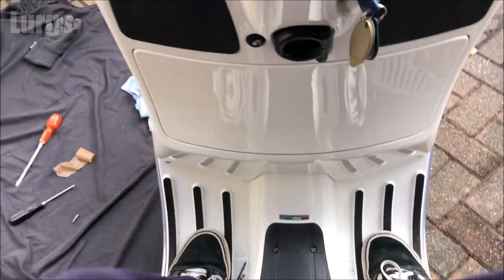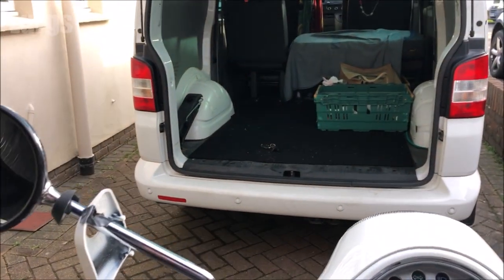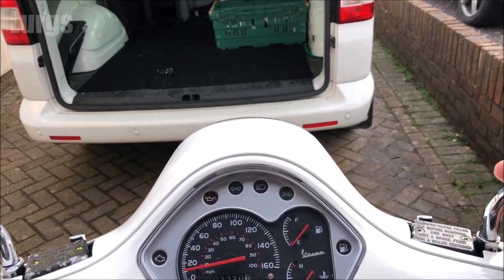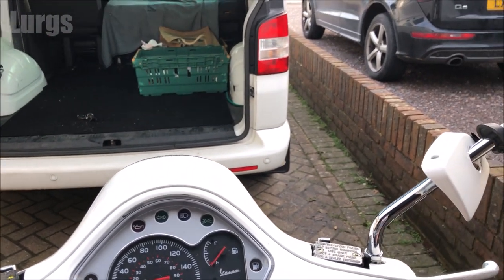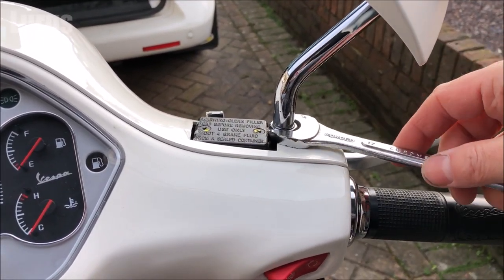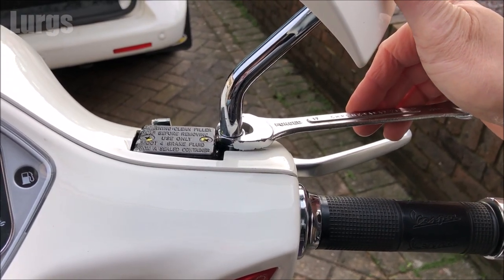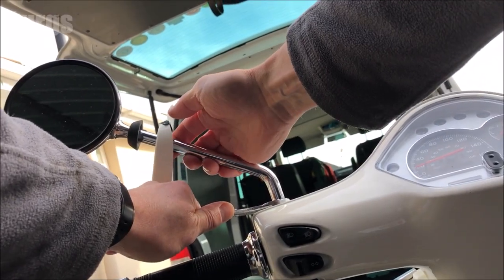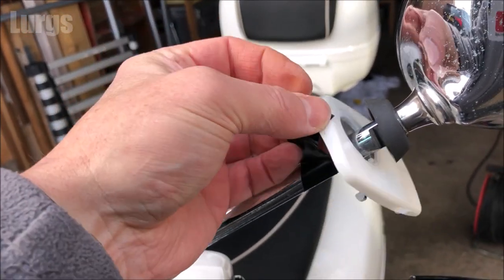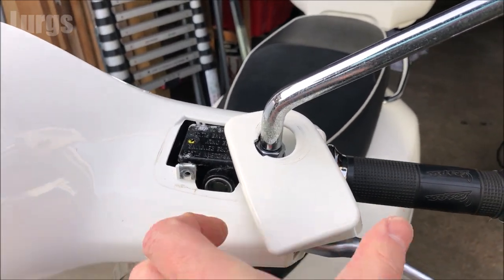Now I'm going to sit on the Vespa and make sure the mirrors are nice and tight and adjusted properly. You can hold the mirrors and adjust those slightly, but to lock them into a specific position you just tighten the nuts up at the bottom of the wing mirror. Get it as good as you can so you've got a good view behind you, then with one hand tighten that nut clockwise and with the other hand hold on to the wing mirror shaft. Minor adjustments can be done on the mirrors themselves — they do actually swivel on a joint.